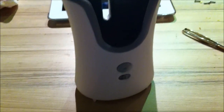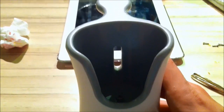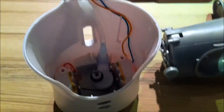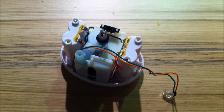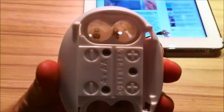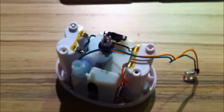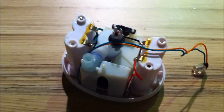After you unscrew the four screws in the base, you can get the gray cover up by pressing the eject button and pulling on the gray bit to get the entire thing off. This is the inside of the soap dispenser. To further take it apart, unhook the proximity sensor and guide it down so you can take off the base from beneath. I've unscrewed the four screws in the battery sockets, and this is the inside of the soap dispenser. I'm trying to get it to dispense less soap because the amount coming out is a bit much for my liking.